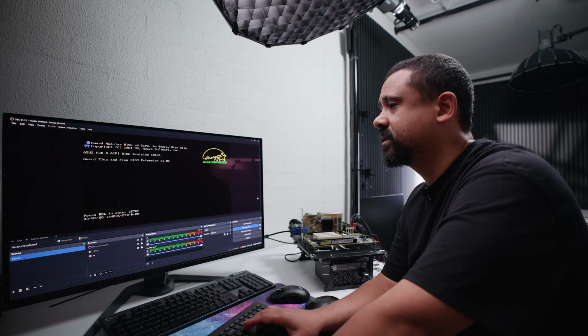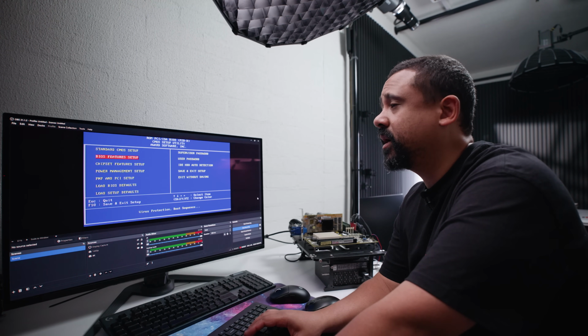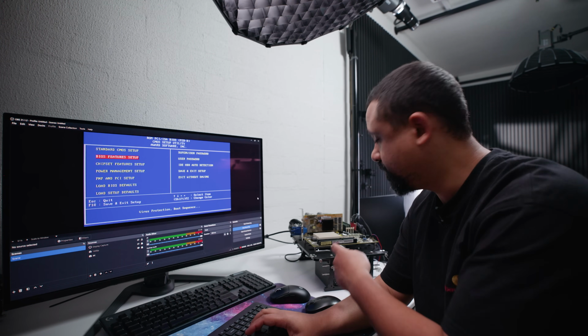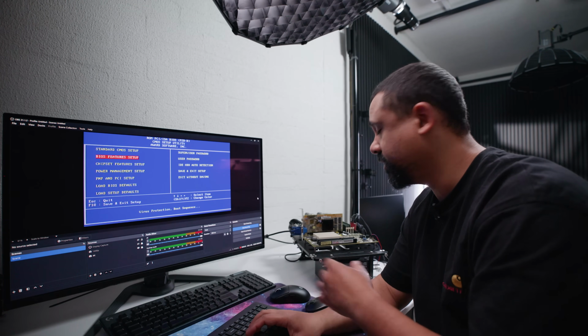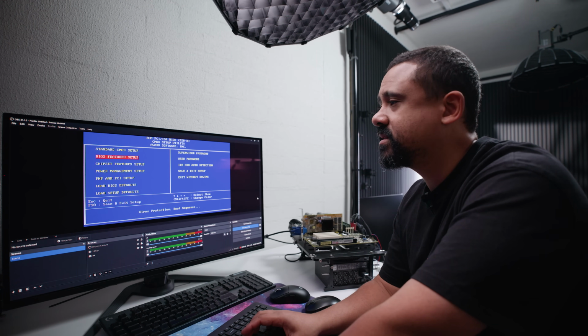That sucks. It does have the original BIOS on it. Maybe, just maybe, I can update the BIOS on here. Boards like this, I can pull the chip off and bench flash a newer BIOS to it. Because what I do is I just back up the BIOS. I have EEPROM readers and programmers. I could just do it. I have all of the nerd stuff, guys. Don't worry. Okay, let's get a BIOS update on here and see if we can boot in.